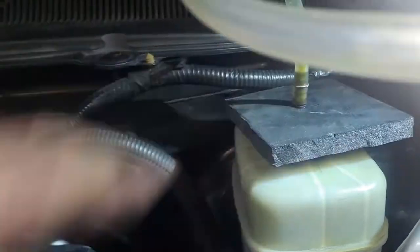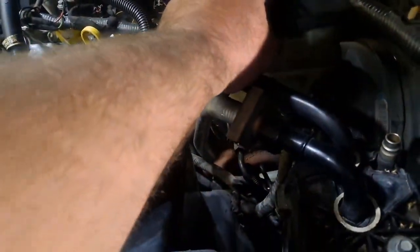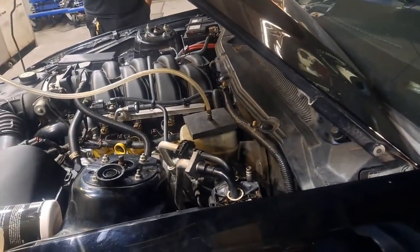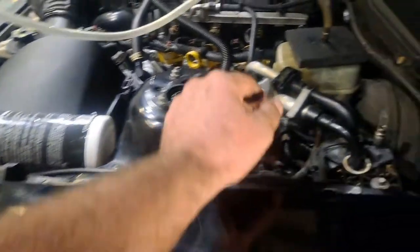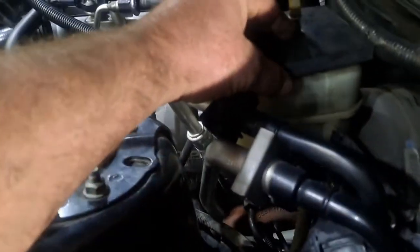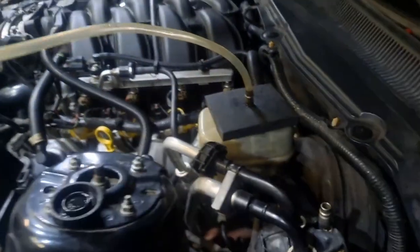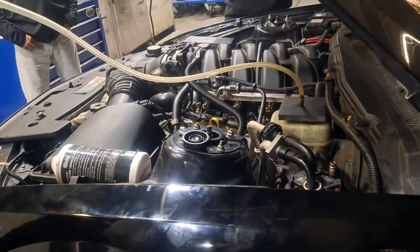And then what we could do, in addition, if somebody could pump the pedal, Adrian, you take over on the vacuum, and Alex, because it's your car, and you're not even clean, man. You're gonna get in your own car all dirty. So this is the special service tool. Get any pedal yet? Keep pulsing it. And then definitely mind his paint, because that brake fluid, you know what it's gonna do if it touches. Still nothing? Starting to come in. All right, so we're gonna continue this method. One more? Yeah, give it a little pulse.